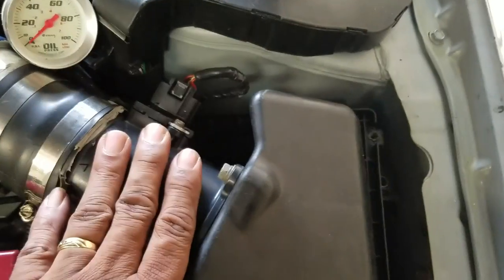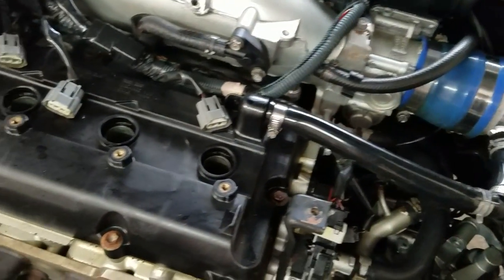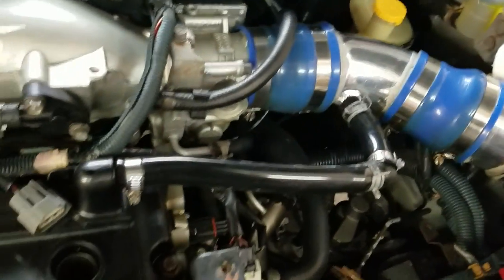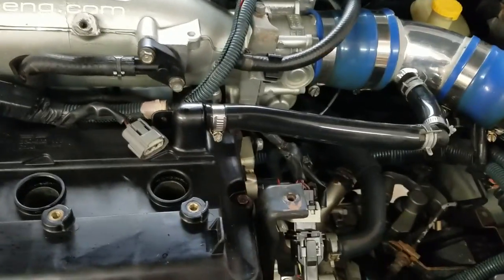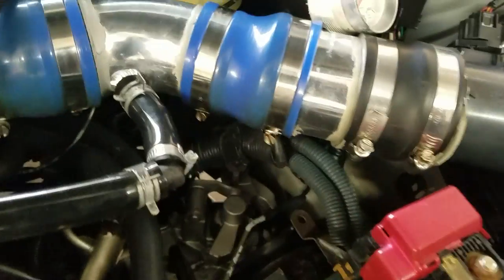This is my mass airflow sensor right here. What the code is really saying is that air coming past the MAF is being metered, and the computer is giving the correct fuel-to-air ratio of 14.7:1 through the injectors. But if air is getting in from some other source and is not being metered by the MAF, the computer doesn't know there's more air being added, so it's still adding the same amount of fuel — and you're running lean. That air has to be coming into the engine somewhere along the intake path.